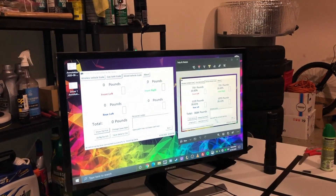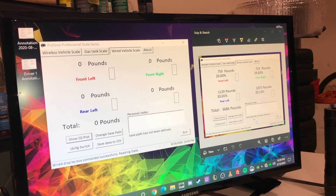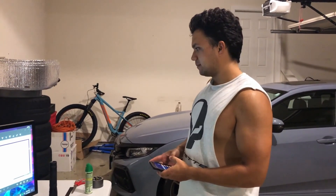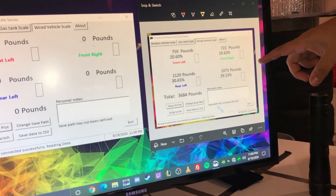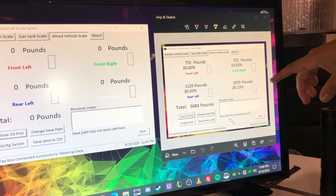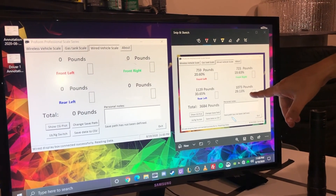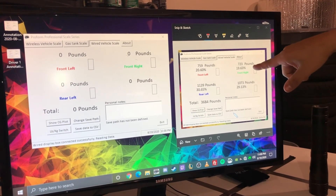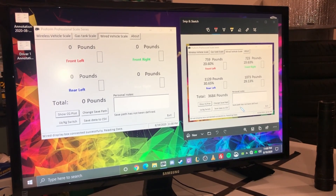So we got pretty lucky — we went ahead and dropped the car as low as we could get it, which from the factory is about 20 millimeters. We brought the coils all the way down that full 20 millimeters, and we're coming out at about a near-perfect cross. It's not ideal so we're going to adjust it a little bit more, but we're actually really lucky to be starting here. The way you balance the cross weights is: you're trying to make the front left plus the rear right — which is about 1,800-something pounds — equal the front right plus the rear left cross weight, which is again something around 1,800 pounds.